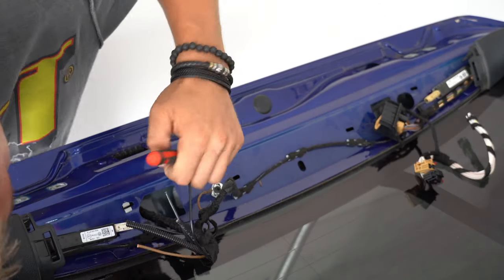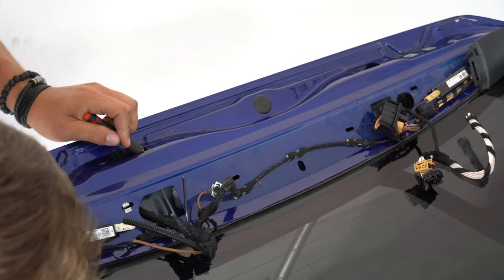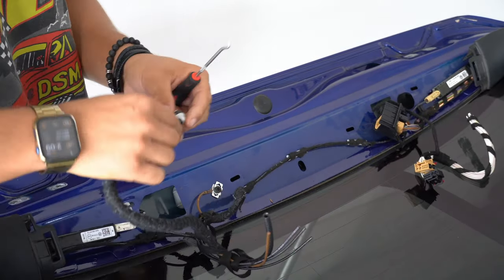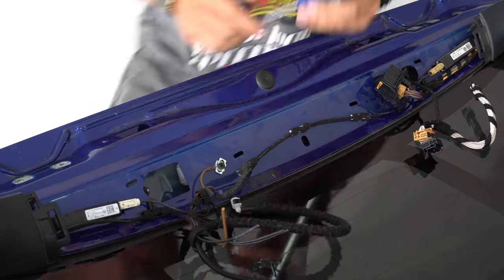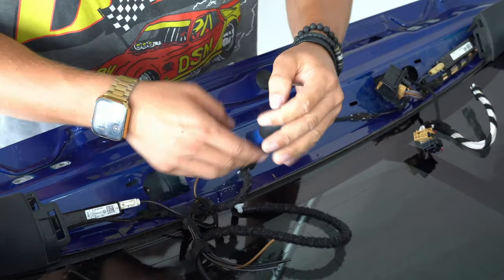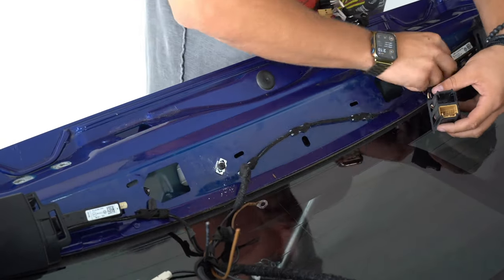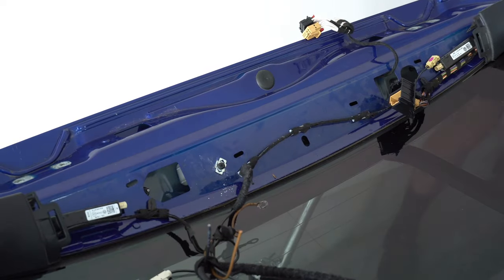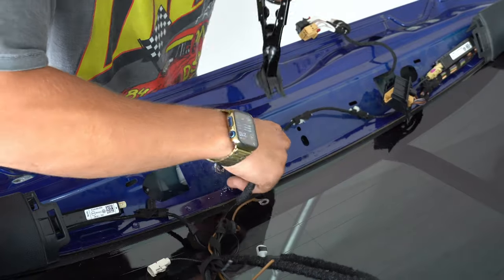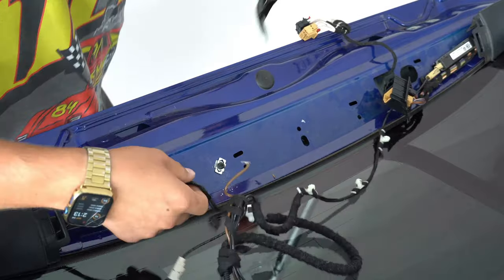The next piece I removed is a bit tricky. It's the rear windshield washer hose, and it has the same clip on it like the ones I removed in a previous video on the hood of the car. Next up was removing the ground wire, which is held in place with a screw. I put the screw back on also just so I wouldn't misplace it. Now, I'm not sure what these white and tan plugs are for, but those can easily be unplugged too. Once unplugged, I used my fancy clip removal tool that I got in a kit when I was removing the dash trim. And if you want the kit, I'll put a link to this in the description below.